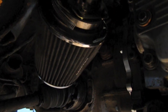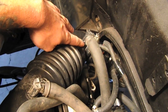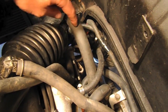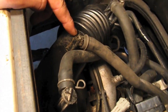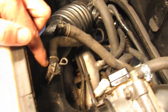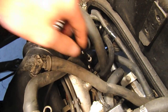It should get slightly cooler air down there, however you may need to wash it more frequently. I took a heat gun and slightly melted the plastic to turn the IAC valve's connection so that it meets up with the IAC valve better — normally it comes straight out. I did the same with one of the vacuum hoses for the valve cover breathers. I cut off a little bracket that was in the way.